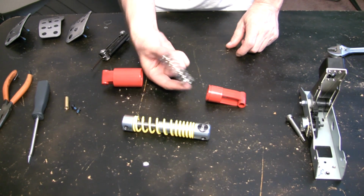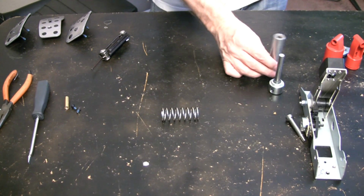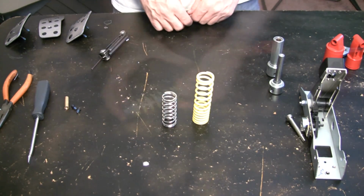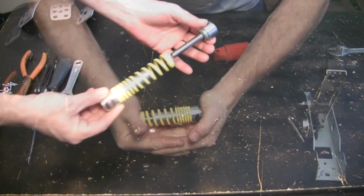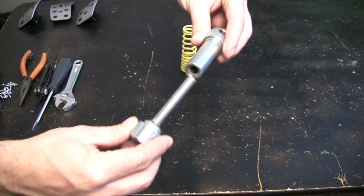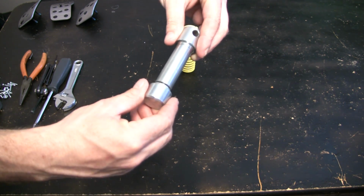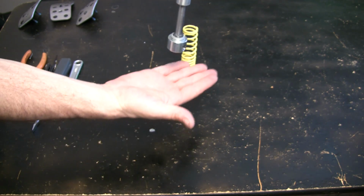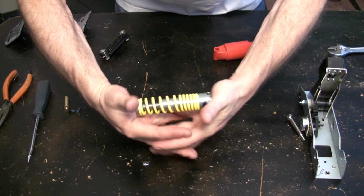It's a very simple, lightweight spring. The ARC brake starts with a very heavy-duty spring that is progressive so that it gets stronger as more pressure is applied. It also has a cylinder and plunger type device that makes it seem a little bit like a shock. Despite not having an official seal, the grease inside acts like a seal and adds a little bit of dampening to the assembly. They also added a small amount of rubber to prevent metal on metal bottoming out.